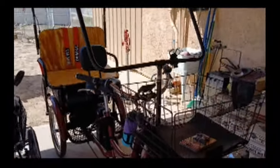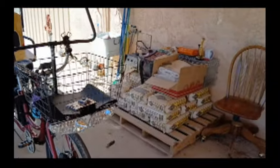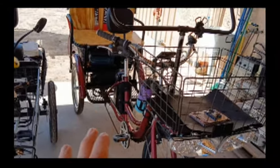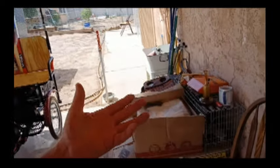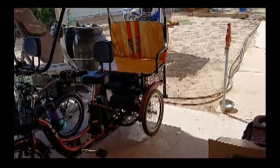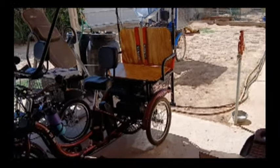It's like tuning a guitar, you know, you stretch the strings. Everything's in tune, it feels fine, but then the strings stretch. And these spokes, that was a little bit more stretch than I can imagine. They weren't actually threaded up to where they should have been. These spokes are engineered so that a good starting point is pretty much there if you just thread it down to where the threads disappear. That's what it's engineered to be on most of them. And it happens to be on these too, but it was unthreaded quite a ways from that.